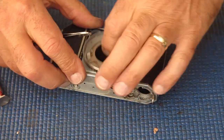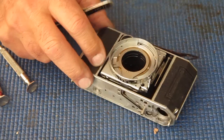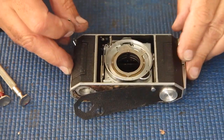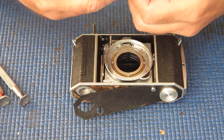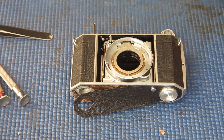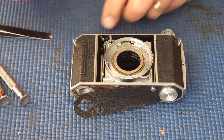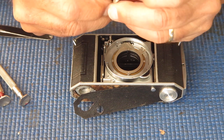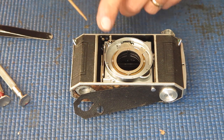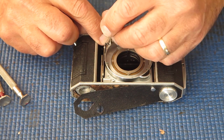I'll put the coupling gear and its shroud on the front here, and then we can put the door back on there, I think. Alright, let's see what we can do. This guide needs to go on there. Just checking there was no moisture in here. Apply a little bit of grease to the inside, some to the outside where it runs through this support bush, and a very small smear on the front face where it's retained by the shroud.